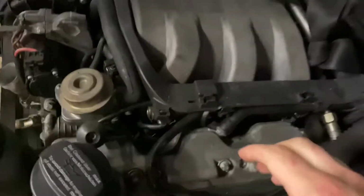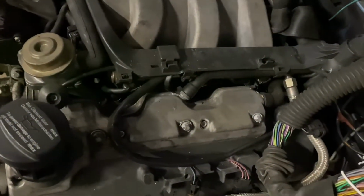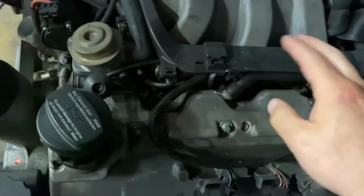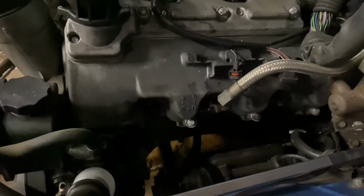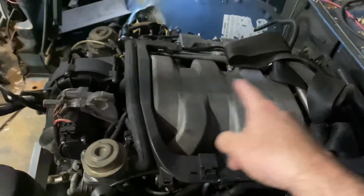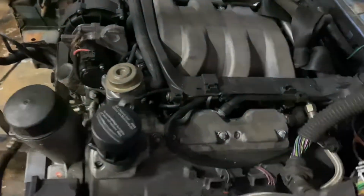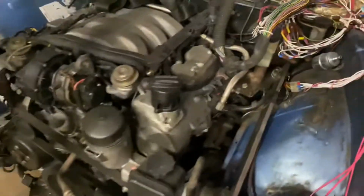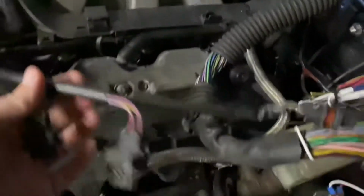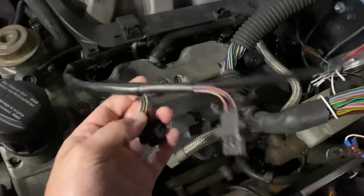And what we're looking at is every injector, we're gonna have two wires because there's only a solenoid inside of an injector. So we'll have two wires coming out of each port, which would be 6-cylinder on this one. So I have 1, 2, 3, and then 4, 5, 6, as where the Mercedes is straight. So we'll have 6 in a row. If we walk over to this side, well actually, right here, we'll have 1, 2, 3, and these will ignite the coil: power, ground, and signal.